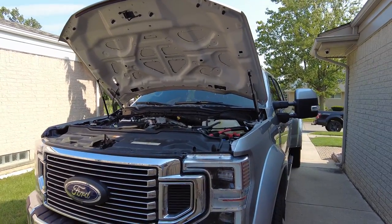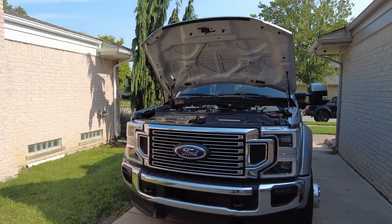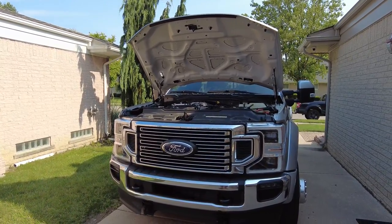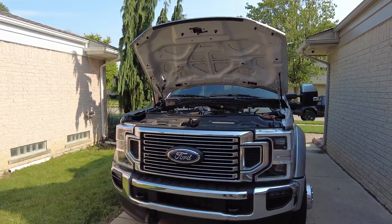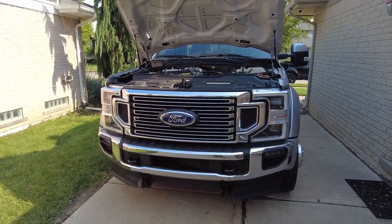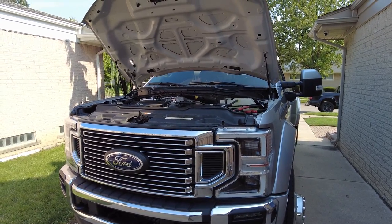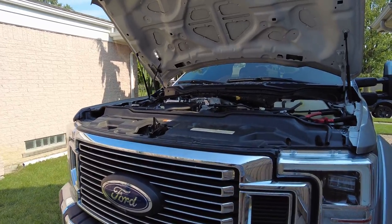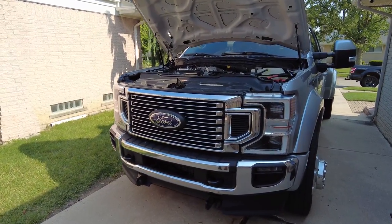Sometimes the biggest is not the best. If you're thinking about doing this on a truck without adding battery banks, consider a smaller inverter — not the 3000 watt pure sine wave. Maybe a 2000 watt or 1500 watt. A thousand watts would work too; you can run two Milwaukee superchargers with that. The stock inverter at 400 watts max is really only good for cell phone chargers and a smaller laptop. Anyway, that's it for our power inverter install — comment below and tell me what you think. Thank you for watching DS Trucks, my name is Sean, see you in the next video.